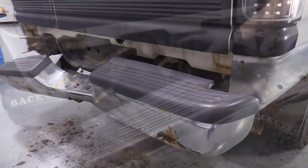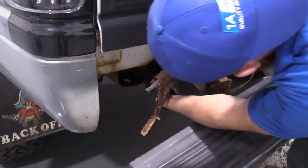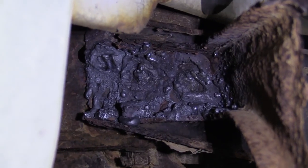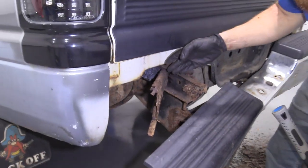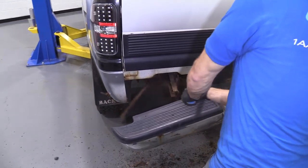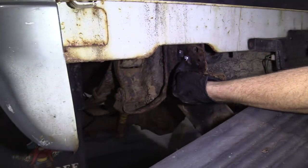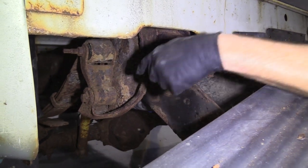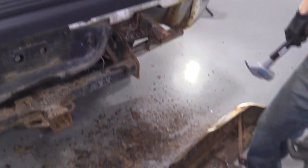I'm going to try to bonk this thing out of here — just going to grab my hammer. So this side right here, we have a nice clear view of what's going on. Where we cut — which is still pretty warm, so I'm not going to touch it — there are studs that come through from the other side with a bracket. If you don't cut those far enough, or take off the nuts completely, this bracket won't be able to come off. I can continue cutting, but first I'm going to give it a couple of bonks and see if I can help it along. Now we have our nice clean holes for our brand new bumper bracket. We'll come over to the other side and do the same thing.